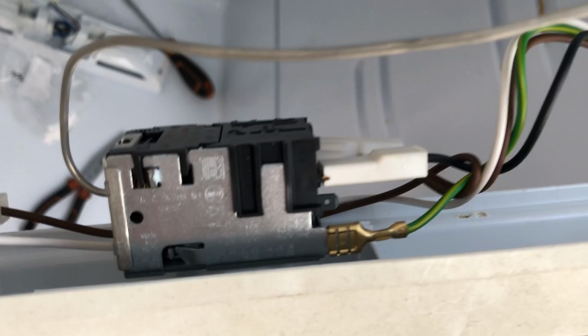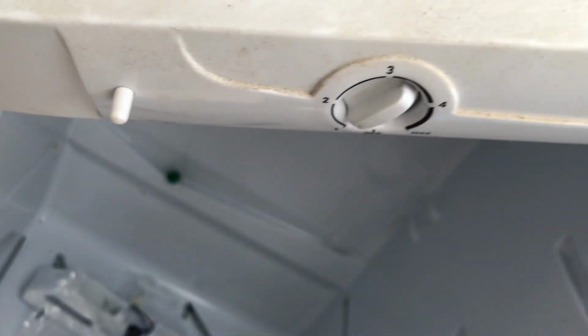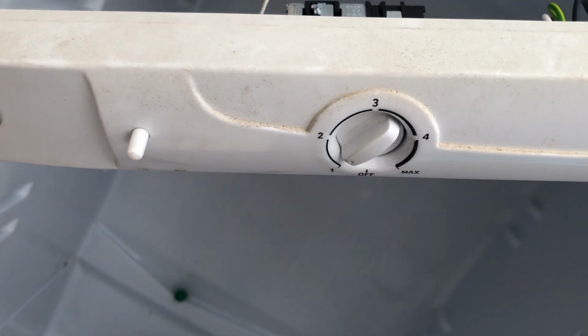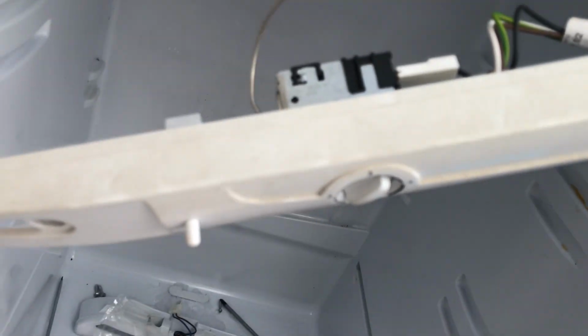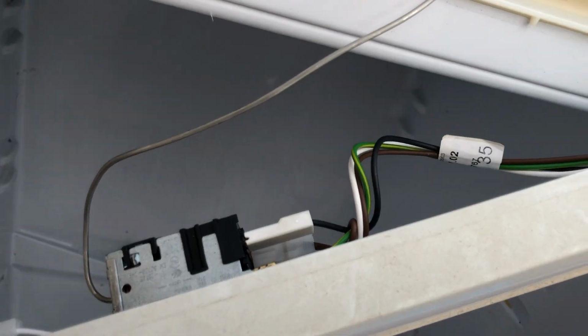Okay, so that's in place now, so connectors all on, thermostat wire itself all routed, and the front nut on. I did need a pair of long nose pliers just to get that nut started, and then the 14mm nut runner after that to get it in. There's the old one down there. So now we'll get this front panel screwed in, make sure that the actual thermostat wire itself isn't in any way inhibited, and then we'll give it a test.